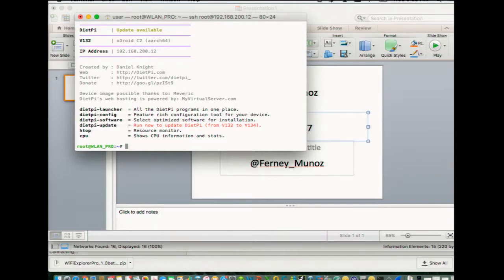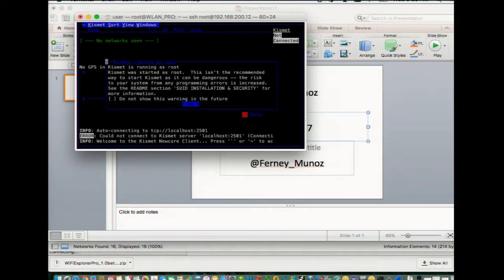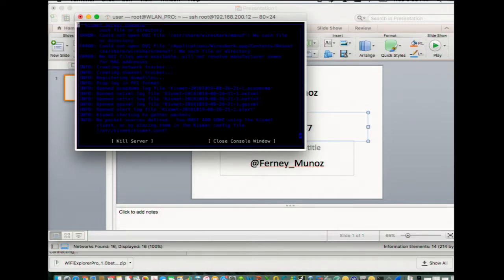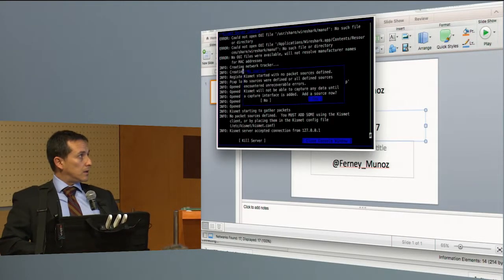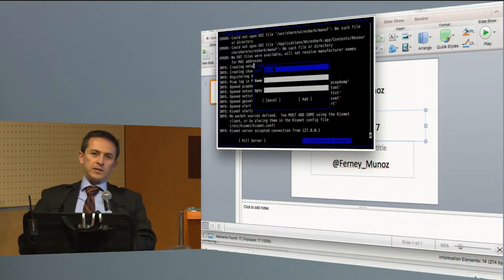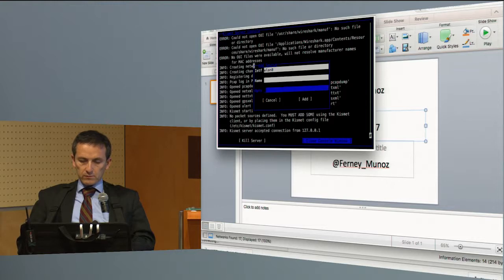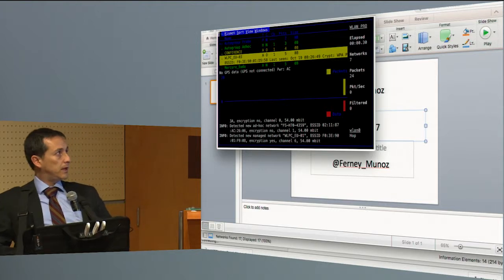One of the things we can do, and it's already in the image, thanks to Jerry Oya from Ekahau, is Kismet. If you just start it and follow the defaults, it's going to start collecting data. It's going to be a sensor. It's going to say you don't have an interface defined. In my case, it's wlan0. You have to pay attention because sometimes, if you have other devices plugged into your Odroid, it may be wlan1. Now I am on wlan0, and I can just start collecting data.